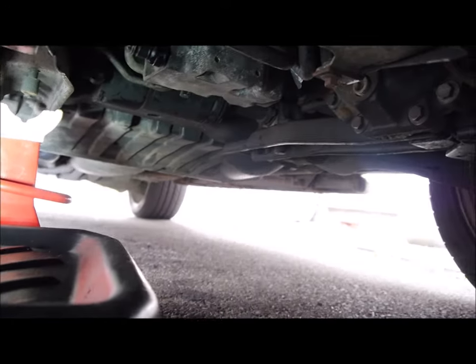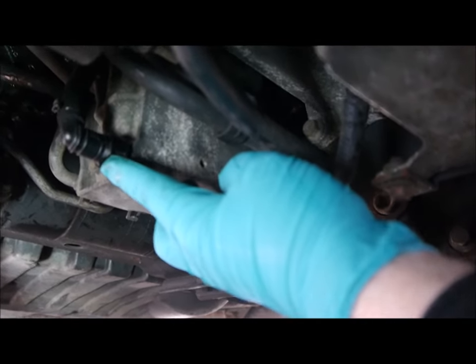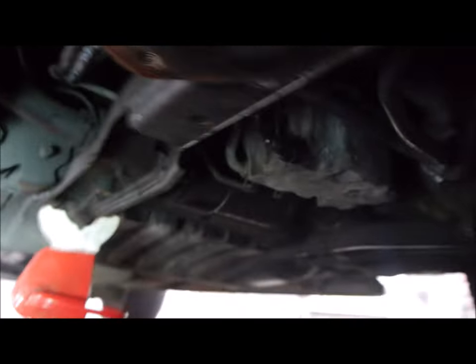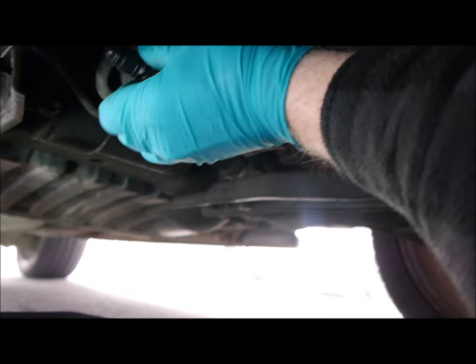Now there's 3 ways really you can get the oil out of this car. One, and I think it's the way to go, is to suck the oil out, and then you're not taking belly pans off cars. The second way is to take the drain plug out, which is here, or you can take this oil drain off, which is actually low, and you just press that detent in and slide the pipe off and hopefully catch the oil. So we're going to try and slide this pipe off here while videoing it and not doing what I did with the BMW and get it absolutely bloody everywhere.